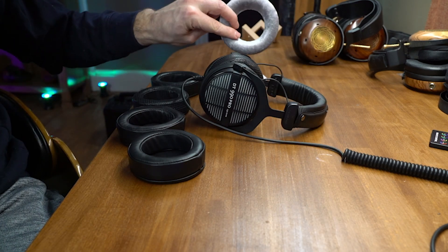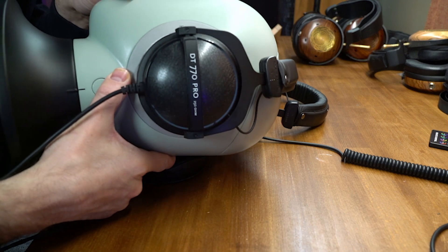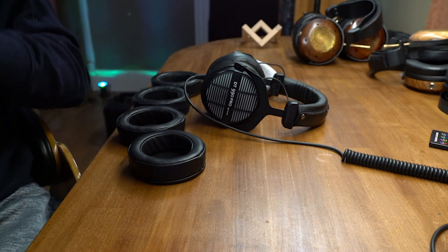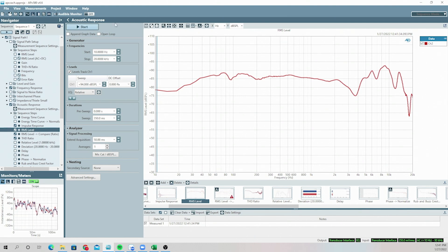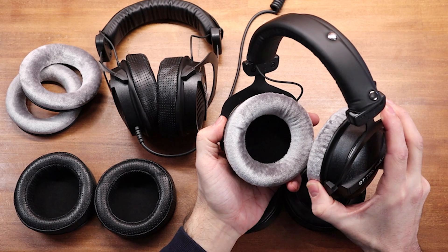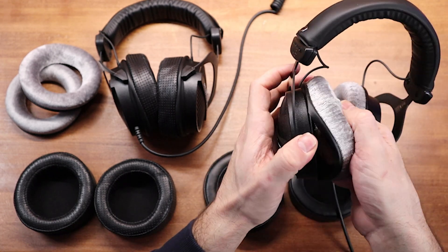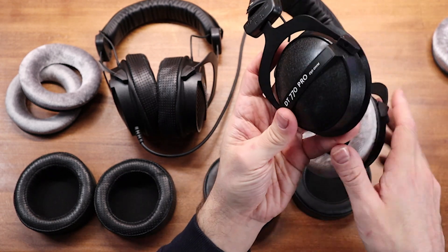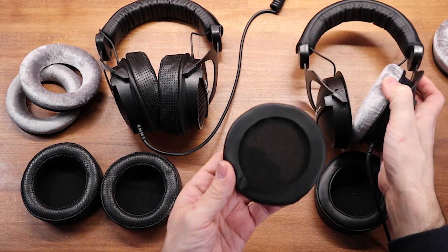I already have the ZMF pads on the DT990, so I got those pads off. Then I have a pair of DT770 Pros here — the closed-backs, 250-ohm version. I'm going to set the Brüel & Kjær HATS unit that we'll be doing measurements on today aside. So that is a general measurement of the right channel of this Beyerdynamic closed headphone. The basics of it is that these pads just go along the outside flap here, and all you really need to do is just kind of pull them off. You can see there's a rim on the outside of the Beyerdynamic headphones, and most headphones have some kind of attachment method like this.